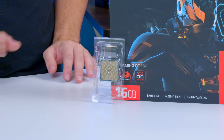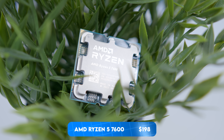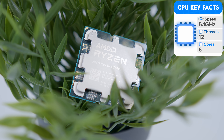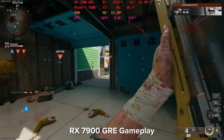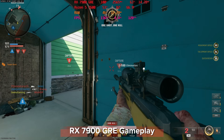Coupled up with AMD's sub-$200 CPU, the Ryzen 5 7600, this is an exceptional bet. This chip has 6 cores and 12 threads and is going to be more at home at 1440p where the GPU is more likely to be the bottleneck than at 1080p. It still provides great performance at both resolutions though, and the GPU remains the most important part when you're trying to maximize frame rate.